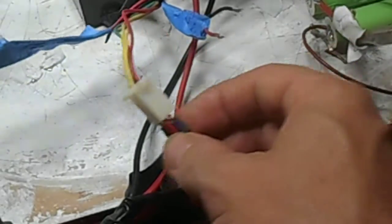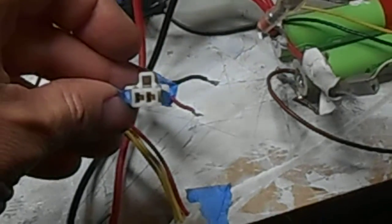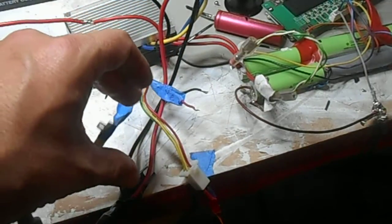The next and final wire I'm going to cover is this wire here, which is the charger port wire. This goes to the back of the charger port, and there are 3 connectors on the back of the charger. As you can see down here, well, it's a bit dark, but basically that's where it goes in there, and there's actually another controller on there. And then from the on-off switch, there's a third terminal which just goes to the negative of the charger port. It's just an earth, I think. I'm not quite sure, but it's an earth just for the charger. And that's pretty well it.